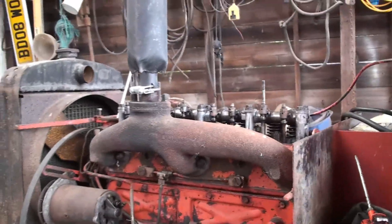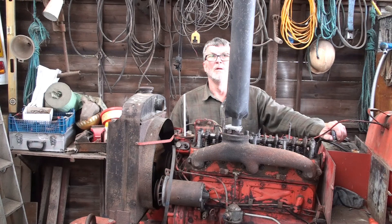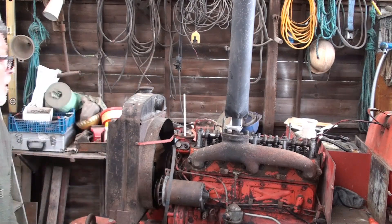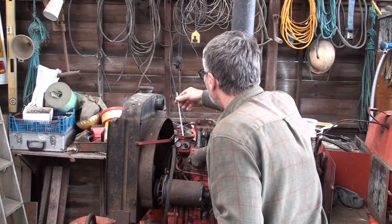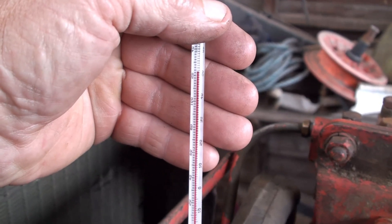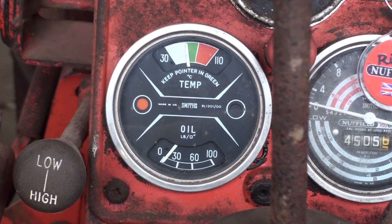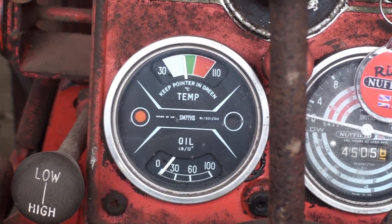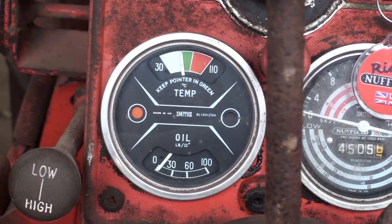Right, I think you've seen enough there now, we'll fire up the engine. I've just stopped the engine here for a second so I can take this reading. As you can see the needles have just moved on to the green and the thermometer in the thermostat housing is reading 170 Fahrenheit or 75 centigrade or thereabouts — just to give you an idea of the temperature at which it enters into the green.